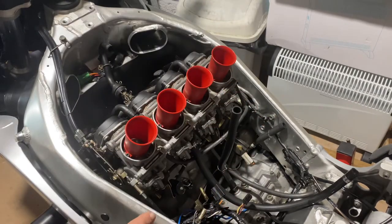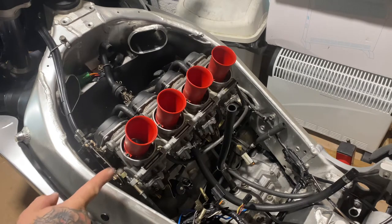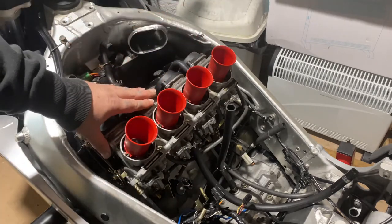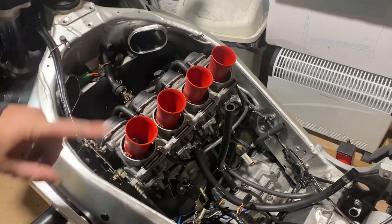And the next thing you want to do, see this little bung here, there's one this side, there's one the other side. Pop that open and get your posi drive screwdriver in, because that will undo the bottom of the carbs where they attach to the engine. Leave your throttle cables in for the moment. Just get the carbs off first and I'll show you what to do then.